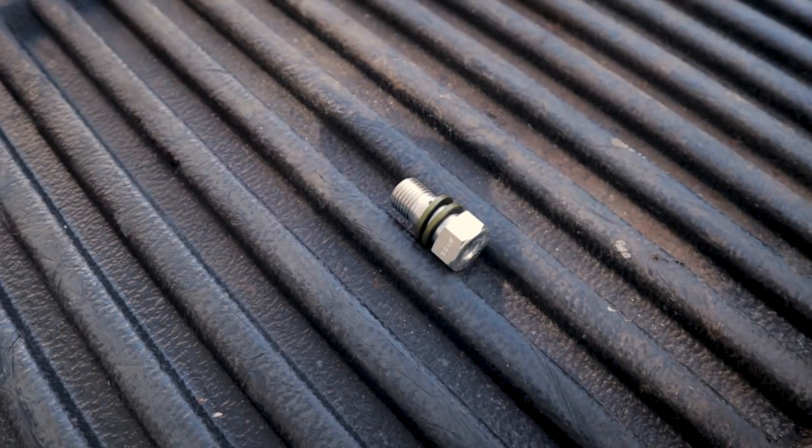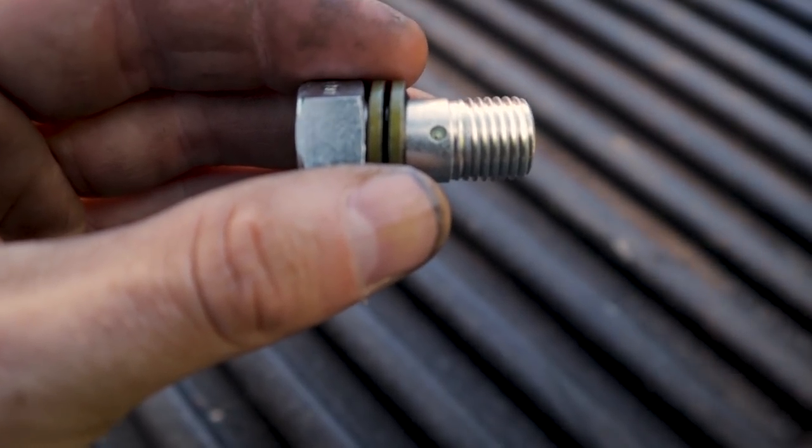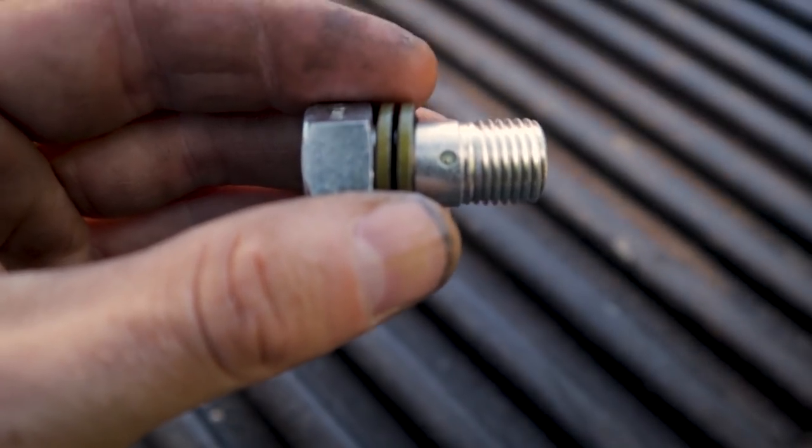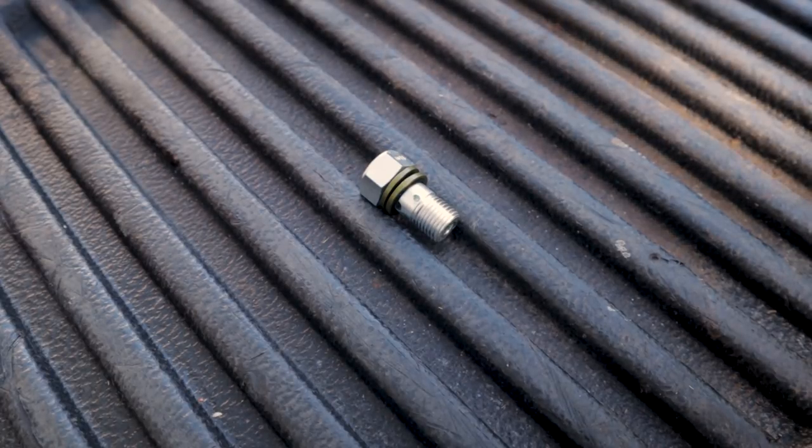Now back on topic with the overflow valve — you guys can see that little hole right there, which has a very small pinhole in it, which is to allow air to bleed off. The overflow valve has a little check valve in it, which is used to route about 70% of excess fuel pumped to the VP44 back to the fuel tank. That check valve is supposed to open at about 14 psi. If the valve inside the bolt is sticking open, then fuel drainage from the VP44 pump could cause hard starting. So if you ever run into a trouble code of P0168 — decreased engine performance due to high injection pump fuel temperature — you'll want to check the overflow valve, because chances are it could be stuck in the closed position.